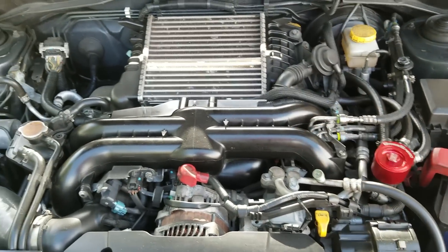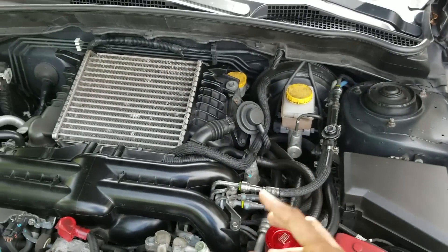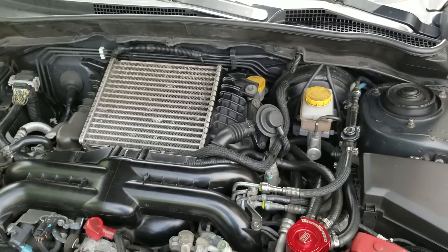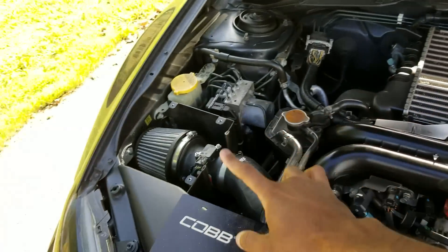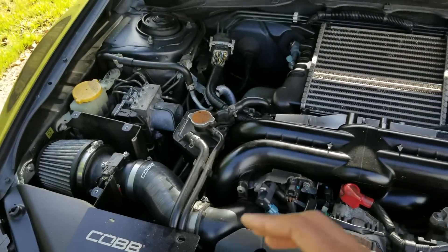To avoid the rich mixture problem, they say to stay running a recirculating bypass valve, which is what this car comes with. The air is not getting released to atmosphere. This bypass valve alone can handle up to 19 to 20 psi, so that's pretty good. It just looks like nothing, but you'll still hear some noise from the intake you added — the stock airbox doesn't show much noise at all.